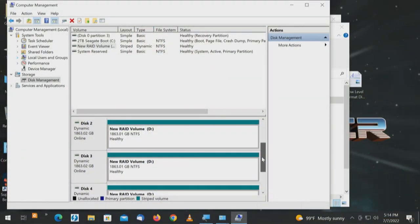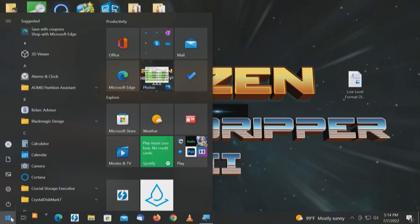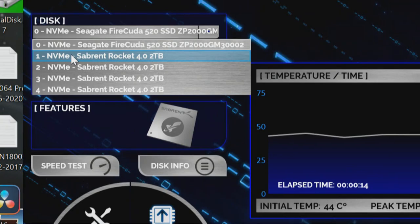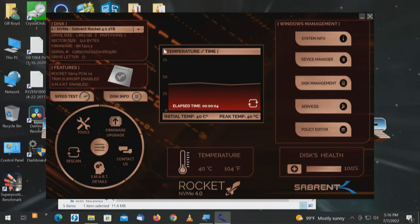I'll have those command links in the description so you'll know what to type — but remember you want to check the drive letter, not just the default which would be the C drive. Since we are in RAID, let's close all that from Computer Management, Disk Management. One quick thing: let's check the Sabrent Rocket control panel. It does see the Sabrent drives. SMART technology is passed through — outstanding. We see drive one, two, three, and four, with temperatures consistent with what we saw.